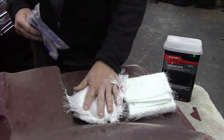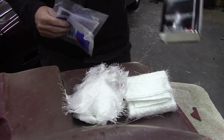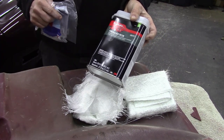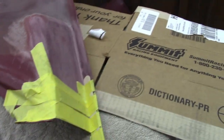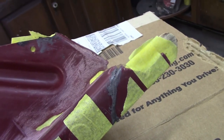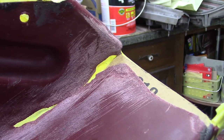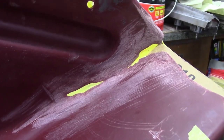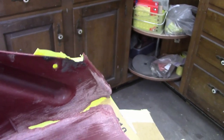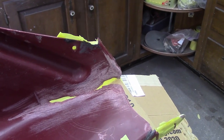This is going to work just fine. We're going to alternate some matting and cloth just to make sure we have a really good structural repair. Mix this up — it's pretty easy. The ratio is on the back: it's one ounce of the resin with 10 drops of the hardener. I just rebuilt this using a popsicle stick to kind of hold that end which had snapped off. You can see I have some epoxy there holding that together, and where the end was eroded I just taped some cardboard in there as a guide for rebuilding that edge, with a little bit of tape to keep the goop from slopping out. I'm going to start on the inside here and get these pieces laid in so that I have a really solid base on the underneath before I start putting fiberglass cloth and mat on the top.